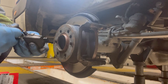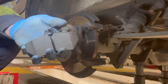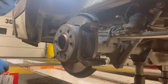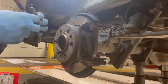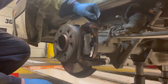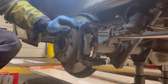The sensor literally just slots in like so. That's how it originally looks. When it gets through to that pad, it will rub the plastic bit off and there'll be a metal bit which will then short out and trigger the warning light. Put a little bit of copper paste on the edges, like that — the pad literally just slots in like so. I'm going to put the other pad in, and then we will put the caliper back together.